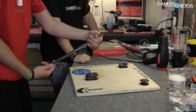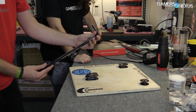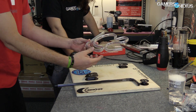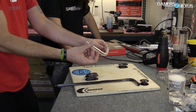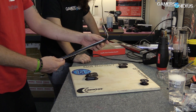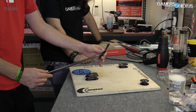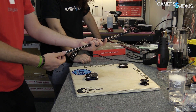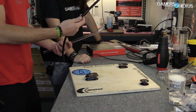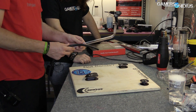It's pretty quick. It's still a little warm to the touch, but not too bad. And then it'll stay rigid like this — once this cools, it's going to be solid. I've done some crazy stuff: spelling out letters, doing other little bends from short little pieces, going from rad to water block, doing bigger runs from pumps where you get some pretty crazy shapes. Also definitely important: once you're done, make sure you remove your silicone insert, because if it dries inside with some wicked bends, it'd be really hard to get out.